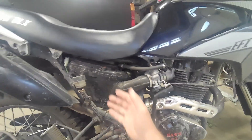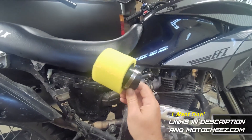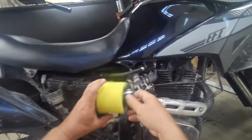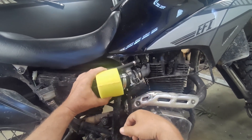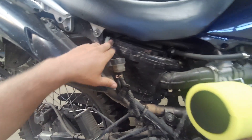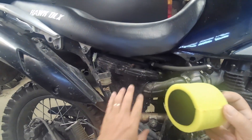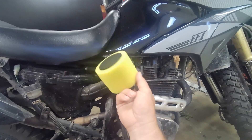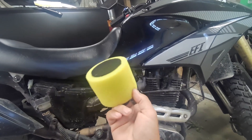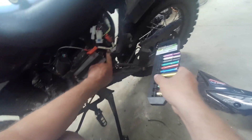Generally I don't like removing a stock air box, because even though these are called cold air filters or cold air filter kits, it's misleading. This pod filter being near the engine will get more heat off the engine, whereas the air box draws colder air through its intake. A lot of people get that confused, but these should definitely flow more air. Let's see what we have to do to unbolt this air box.